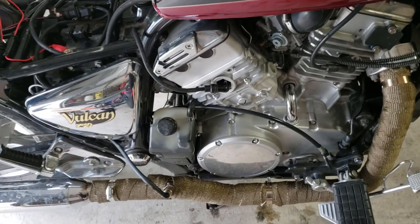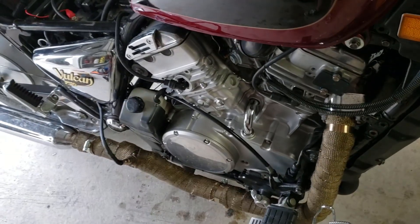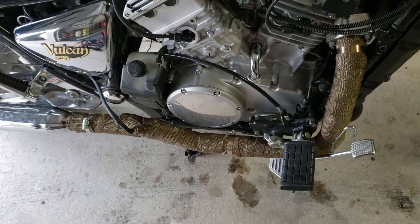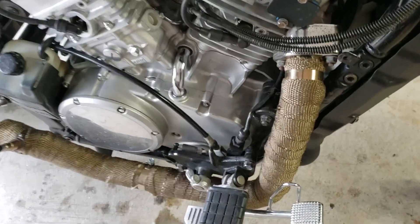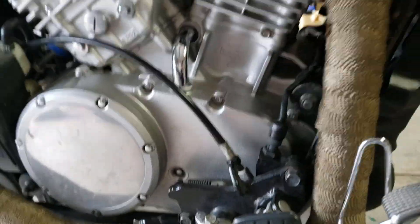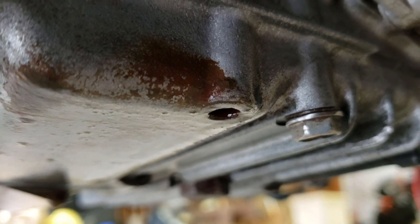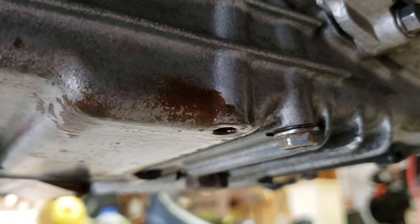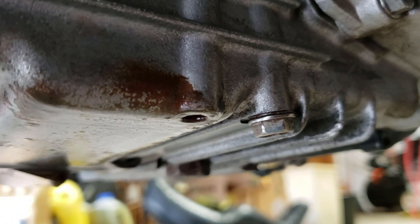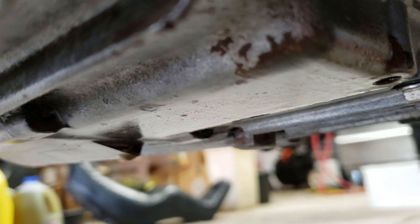So how do you know whether that seal is leaking? It's a mechanical seal, it has a spring in it — I'll show you more about that later. Well, it's got a port they call a weep hole or a telltale hole. I'm sure you've seen them in other applications — they're pretty widely used in automotive. On the Vulcan 750, the weep hole is located right here. At first I thought I was maybe missing a bolt and it was leaking some oil, but it turns out it was a telltale hole, and it's leaking out from there very slowly but steadily — you can see that drip right there getting ready to come down.